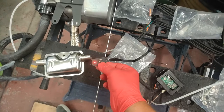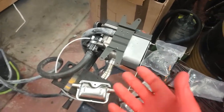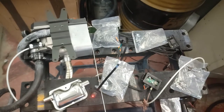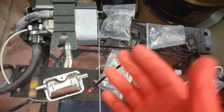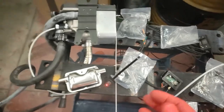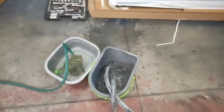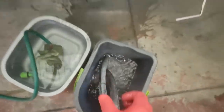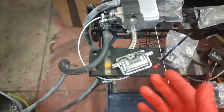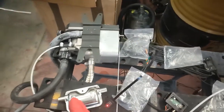Very impressed with the heater and very impressed with everything it comes with. You get loads of stuff: fuel pump, mounting bracket, plenty of hose connectors, wiring loom — massive, lots of metres — pipe connectors, elbows, clips, spring clips, a dip tube for your fuel tank. If you've already got a diesel air heater you could probably T-piece off the fuel supply and run both. Decent quality fuel filter. The wiring loom is comprehensive. That water is too hot to even have a shower in as-is — you'll need to mix it with cold water, or use a hot water storage tank with a mixer tap.